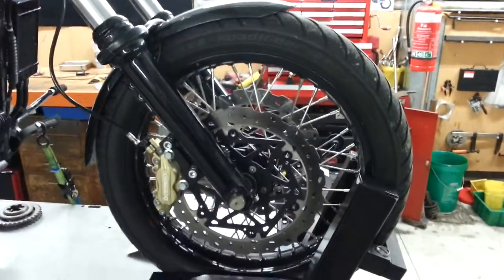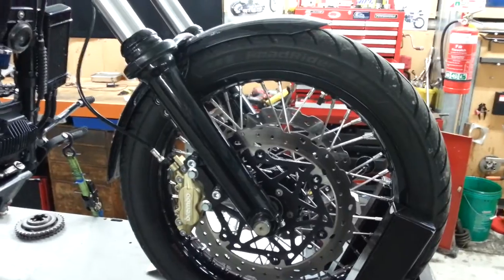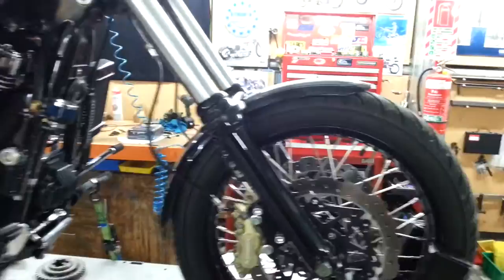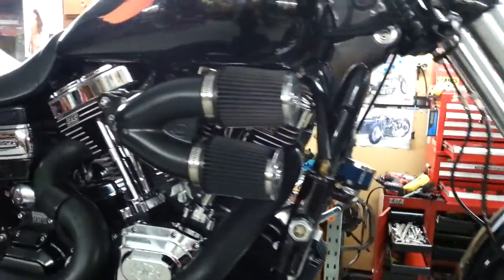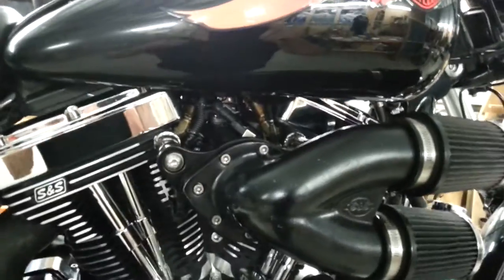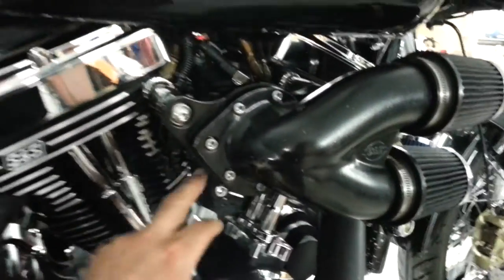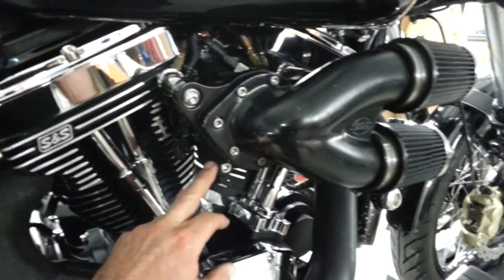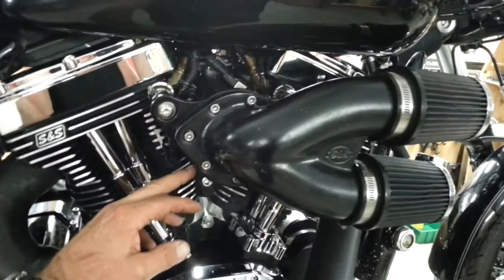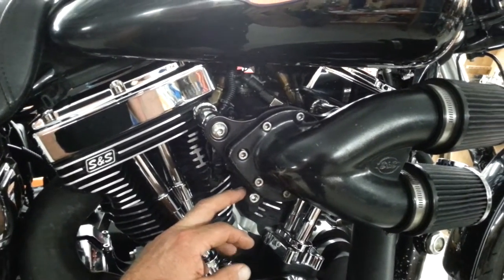The front end has worked out really well. It's not hard to put twin discs on the front of a Dyna - well, it's not that straightforward either, but certainly not impossible and well worth doing. Put the 70 mil S&S Throttle Hog throttle body on there now, it's cable operated. This is actually the third one they made - I was running the 62 mil Horsepower Inc throttle body, cable operated, and S&S has just released the cable operated Throttle Hog so we put that on.